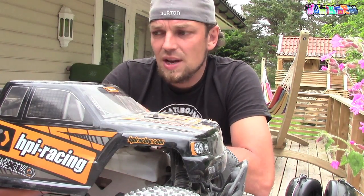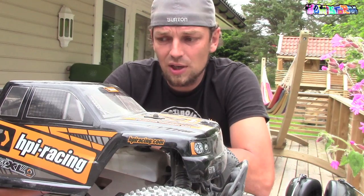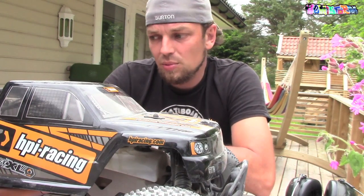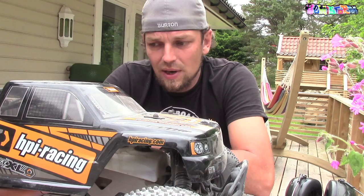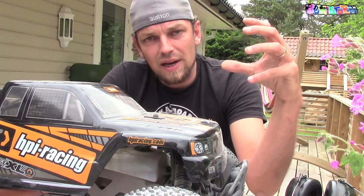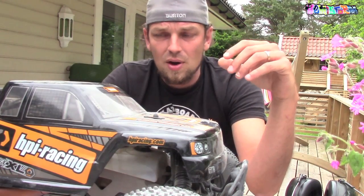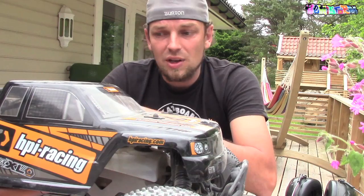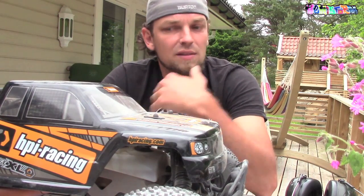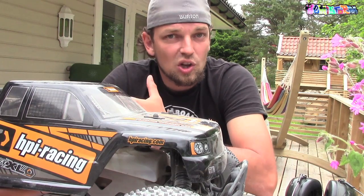Another thing that I must say is the clutch. The clutch on mine gave out really quick. But again, that also could be just my car. I have no idea. What I found is that the clutch plate on which you mount the clutch has 4 pins, 1 broke off. So currently I'm only driving with 3 clutch shoes. You can tell that the truck has a lot of bite, even downhill it wants to wheelie. But there is a bit more potential there, since I only have 3/4 of a clutch going for me at the moment.